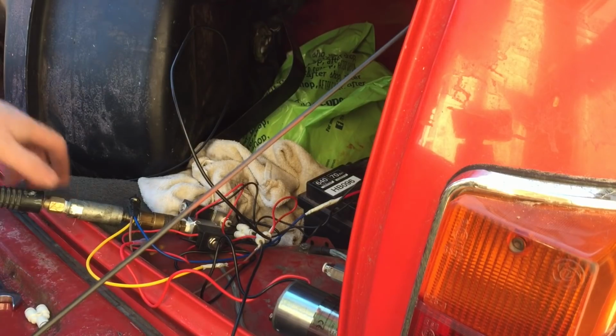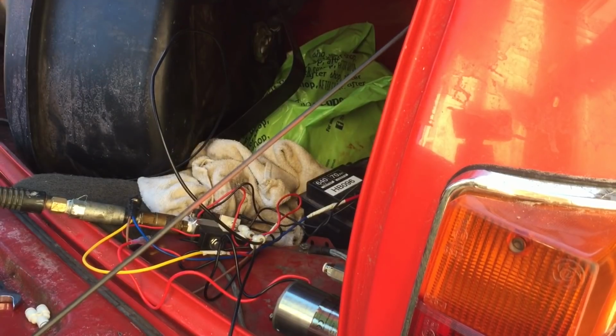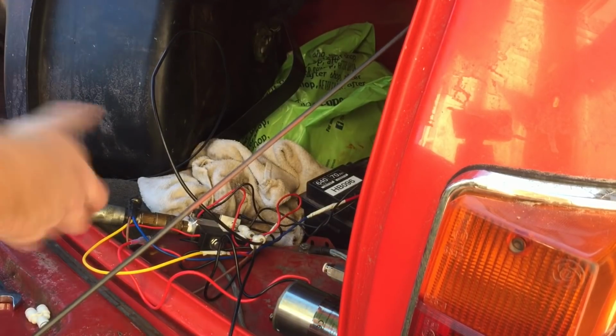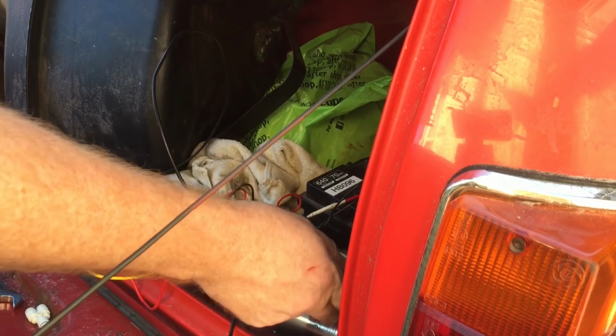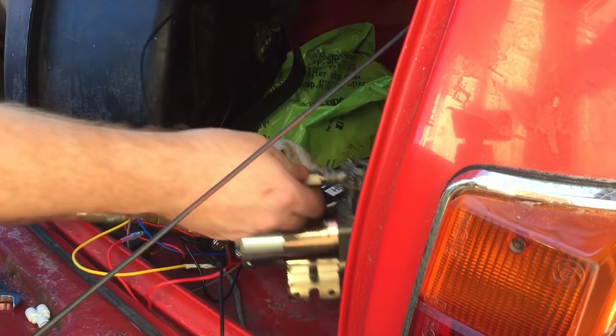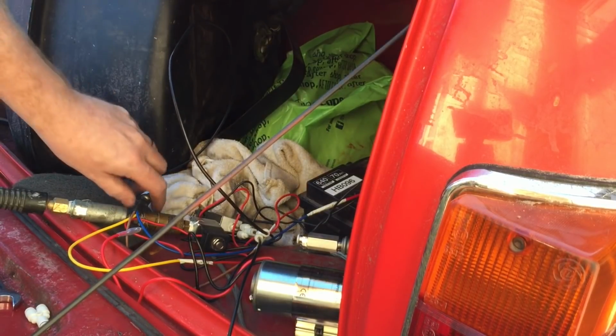But when I disconnect the air on one of these, on the feed, you can hear it slightly hissing. I've swapped them around, inlet and outlet, thinking maybe one's specifically in and out, but it's not doing it. So I could definitely put a check valve, which these pumps come with. That will fix the issue anyway, but it seems a bit strange that it should be leaking.